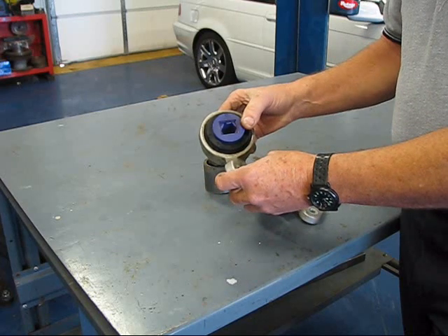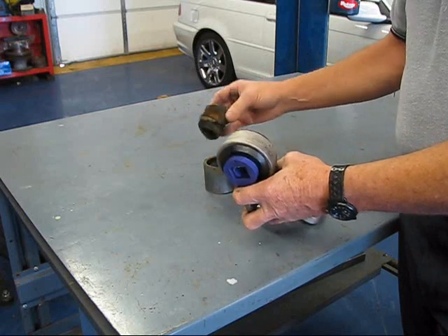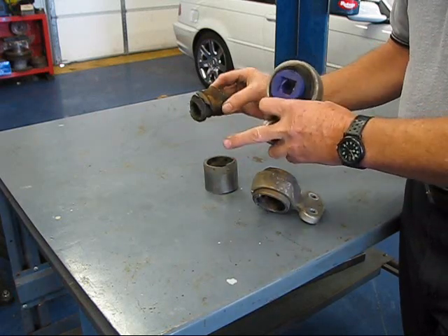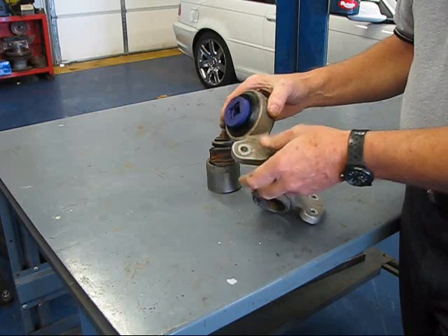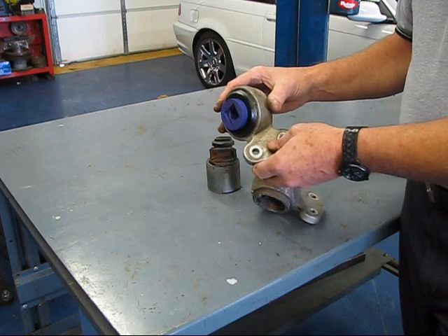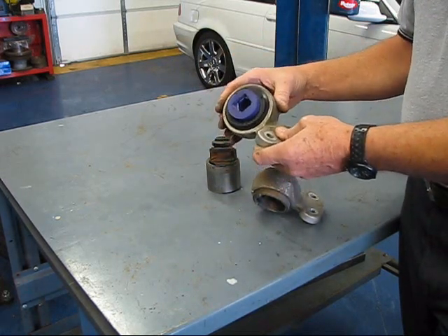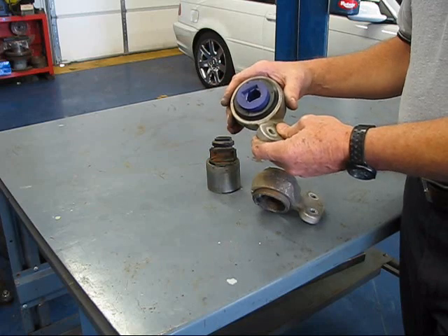It's got a hex drive to match the control arm — it fits onto the back of the control arm and then the component presses inside the bushing and totally bottoms out when it's seated correctly. This is a much stiffer bushing. It doesn't have that flex. It doesn't have the hollow voids that the factory unit does. The factory unit typically only has a few little contact pieces, and once they rip out, that's where you get all that movement in your wheels. This is a solid, performance-oriented piece that works very well as a replacement part — it'll probably never wear out. It's an excellent alternative to the factory and actually a pretty good upgrade. It doesn't deteriorate ride quality that much; it's a little firmer but hardly noticeable to the average driver.